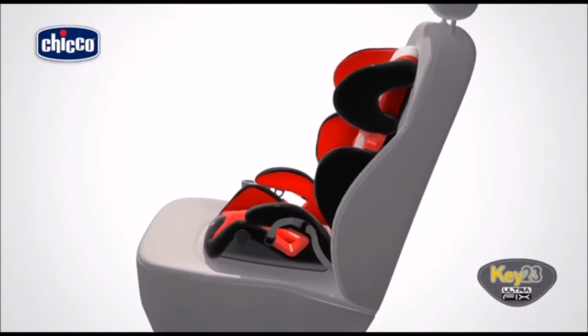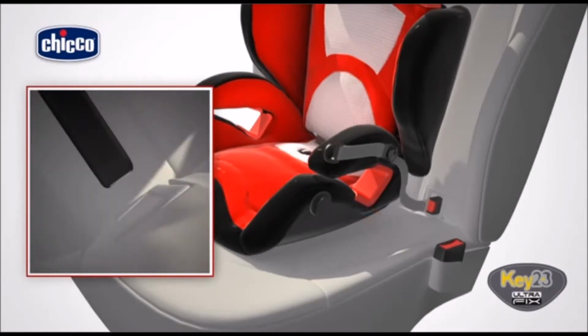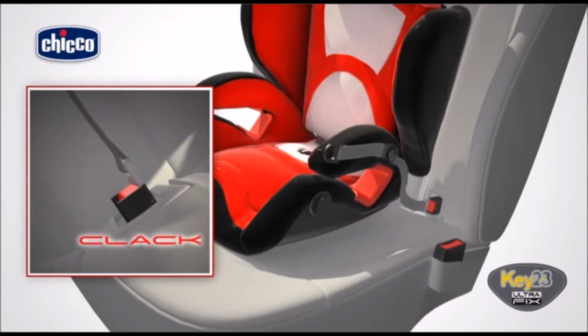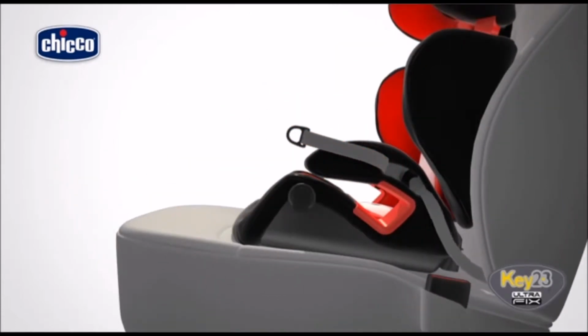Remove the Ultrafix clasps stored on the armrests. Insert the 2 Ultrafix clasps into the corresponding Isofix locking points on the vehicle, between the backrest and the seat. Pull the clasp straps to achieve correct tensioning of the child car seat.